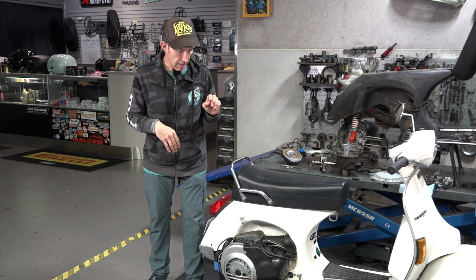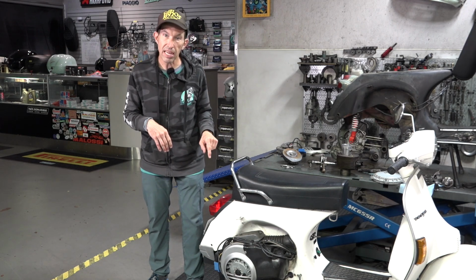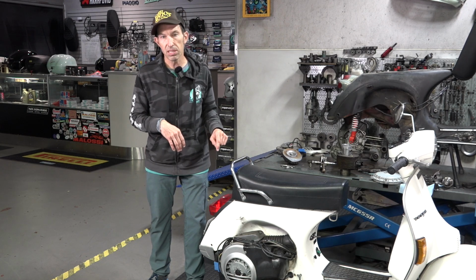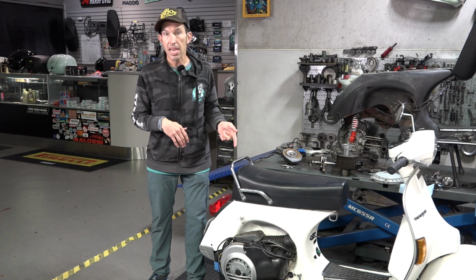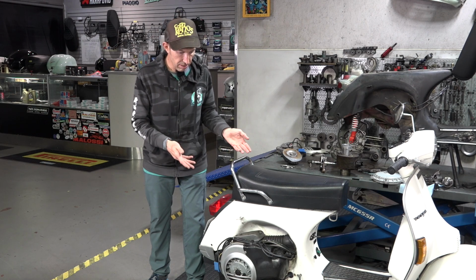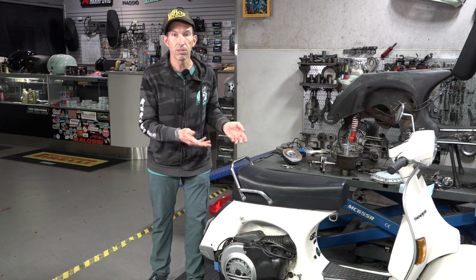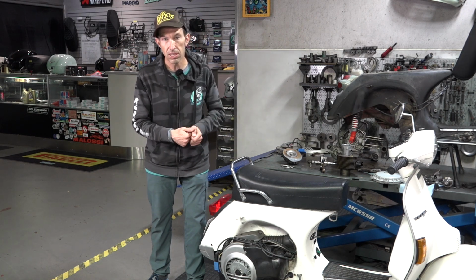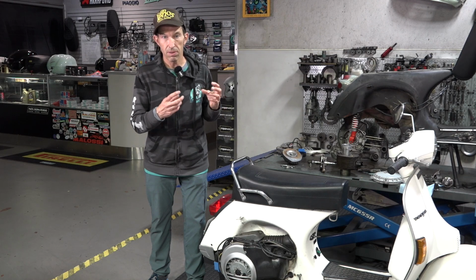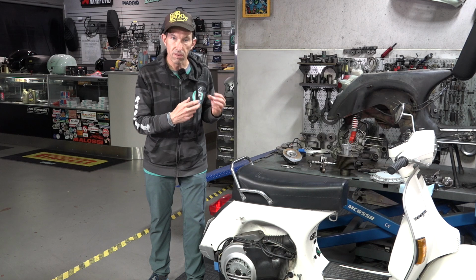We said there's a pretty large possibility that the motor is going to end up developing an air leak or having issues with the clutch starting to slip, and that's exactly what happened. The clutch started slipping. It also developed air leaks on the seals. The crank seals on two-stroke engines are reliant on keeping a seal from the atmosphere for the engine to operate.